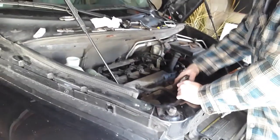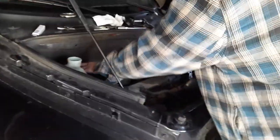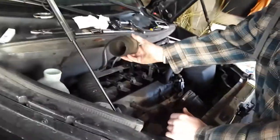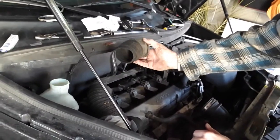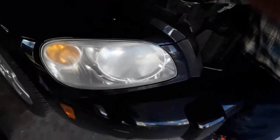The only thing you really have to take off is right here for the throttle body — put that back on. Then you hook this back up, which is the air intake inlet. This is actually what pulls the air from behind the headlight and the fender to get the power.